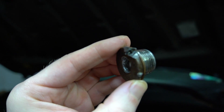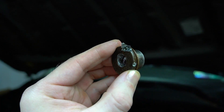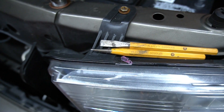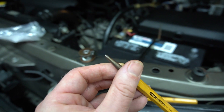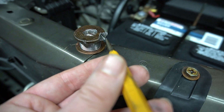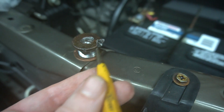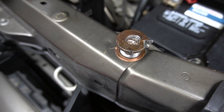What I did was use the chisel to start — maybe the metal is too soft — and then chipped it away, though the threads are kind of damaged. These are the tools I was using: a chisel and one of those pointy hole punchers — I'll post a link in case you ever need them. That's my first choice when removing something like that. Put it there and keep hammering with a heavy hammer until it starts turning. That's how I removed the hexagonal drain bolt.